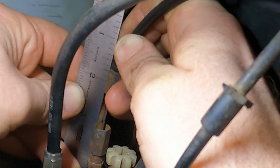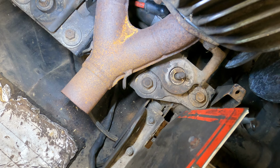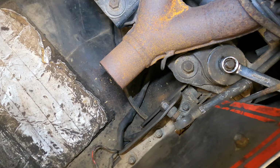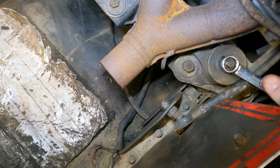I was just looking at this. I haven't put any motor mounts on yet, and I really need to do that before I can't get to this back one anymore. All right, so we got this little hooky doodad we got to put in here before I do much else. This thing goes in here, hooks up on the motor mount, then goes back here in this little eyelet. These motor mounts aren't really adjustable, so I'm not terribly worried about the belt alignment right now. I'm hoping it just falls right back in where it was. So we're running all these home as we get them in.